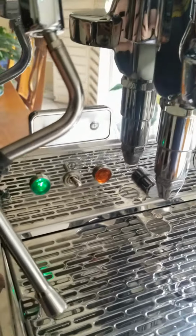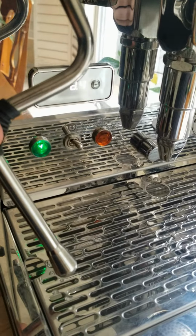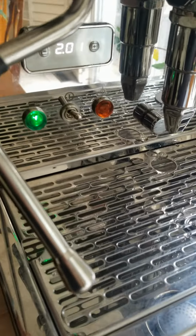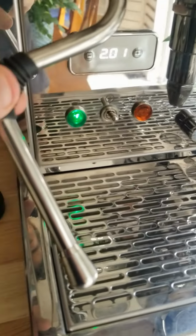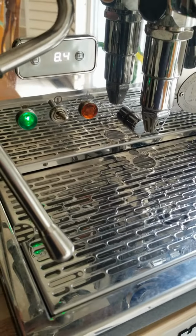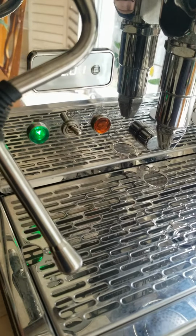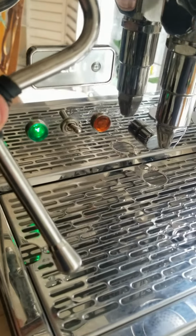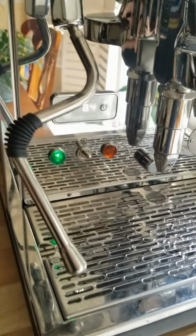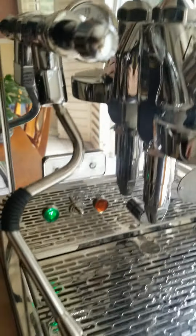Very fast with many holes, and I think that's typical. But there was one option that was another 2-hole tip. So it went from 2 holes to 2 holes. The difference was the holes were much smaller. The original tip had bigger holes, the new one has smaller holes, and that slowed down steaming a lot. Instead of 10 seconds to steam 100 milliliters of milk, it was like 20 or 25 seconds. But it gives you time to texture the milk and inject air and do whatever. Not in that order.